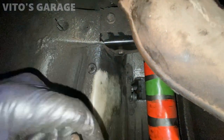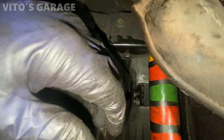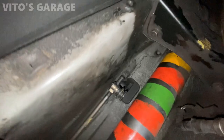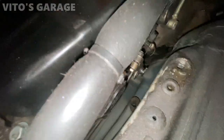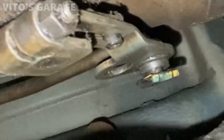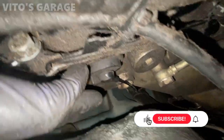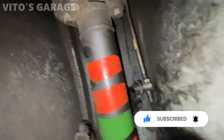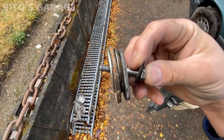I'm gonna put some lube there, reinstall the shifter linkage, and the clip should be good. We'll retest the shifter. Clip is reinstalled, and both bushings are installed. I also replaced this vacuum hose right here while I was in here — it's a brand new one. Both of them are replaced — good to go.